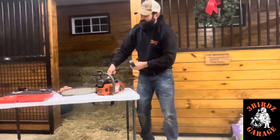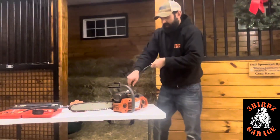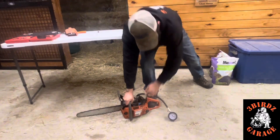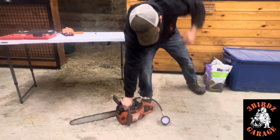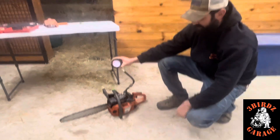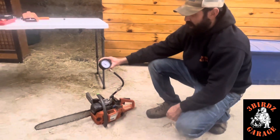I'm not saying these cheap Chinese ones aren't good, but they're not good for small engines — they're not going to give you an accurate reading. The Mityvac is hooked up here. We are at 110, 120, about 125, which is good. That's about what I think it has. The difference is this one has a Schrader valve. I don't know the exact science behind it — maybe somebody can explain in the comments below — but for a small engine, you want that Schrader valve.